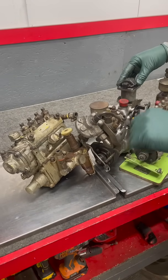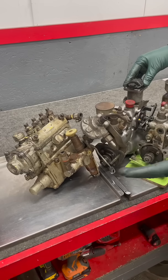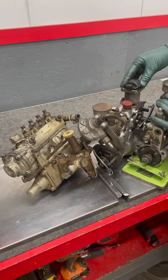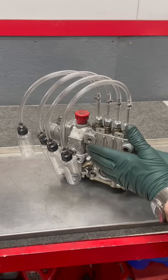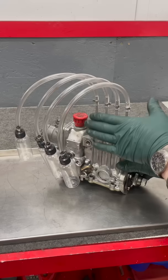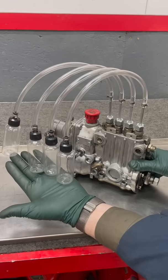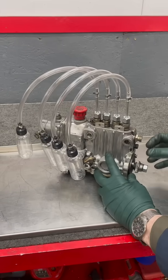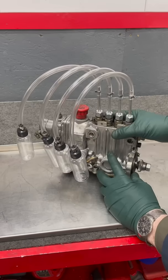I'll put a link below — I'm going to show you a video where I took a 6.3 V8 that had sat 18 years and got it running by cleaning out the pump first. This is the setup I use to clean out these old fuel injection pumps. I can also test them to make sure the flow rate out of each delivery valve is correct, because these bottles will fill equally. I do this by running a cleaner through and using the starter motor to spin the pump over while purging and testing.